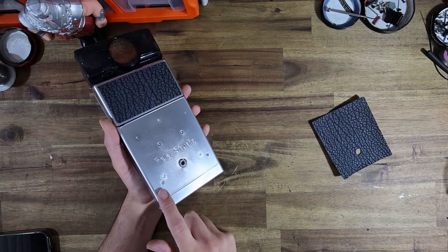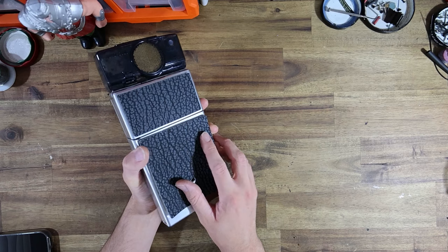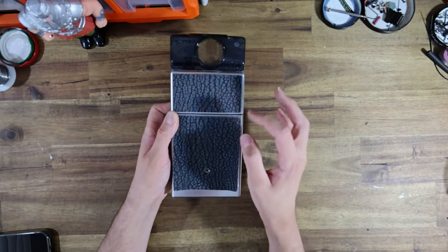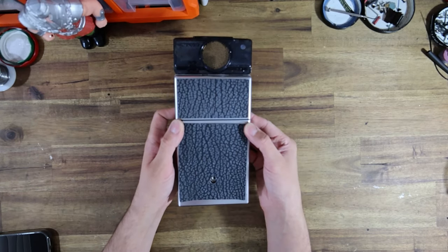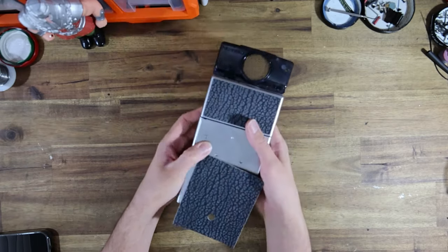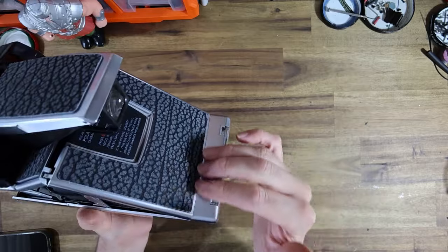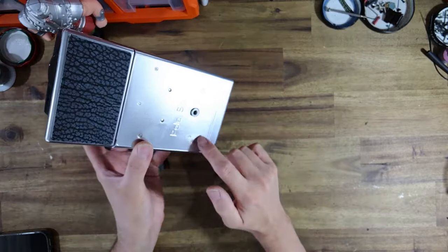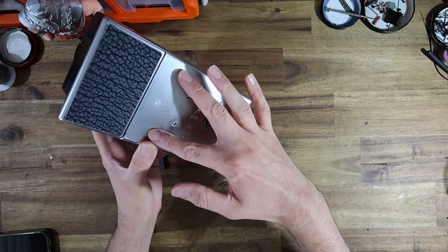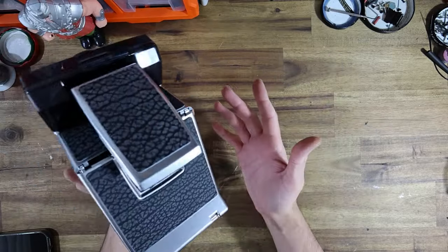He's very likely gonna remove these two screws, and in the leather panel, with the laser cutter or a leather punch, make corresponding holes in the leather so that he can access those two Phillips head screws, and that's gonna hold the camera together really nicely. The shape of the body panel at the rear means that these two rear screws aren't strictly necessary. You can kind of get away without using them, so holding it on with just these two is gonna do a fine job because of the shape of the lip there and how it holds to the camera.